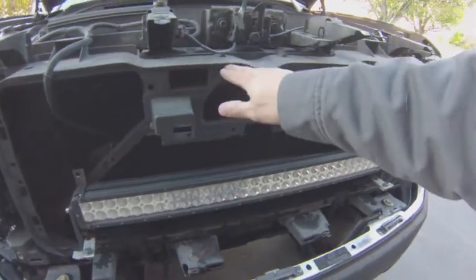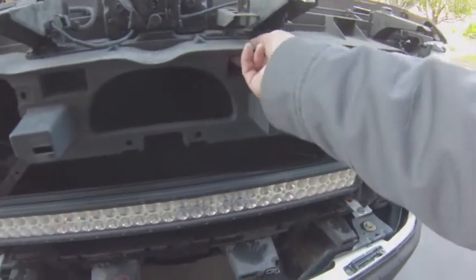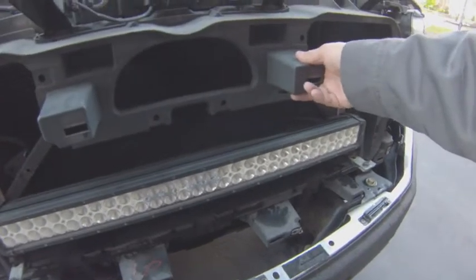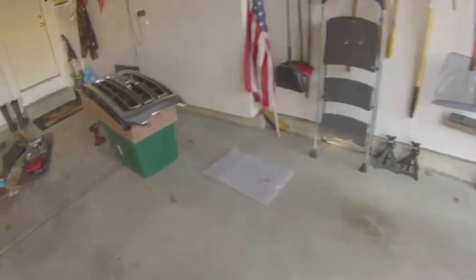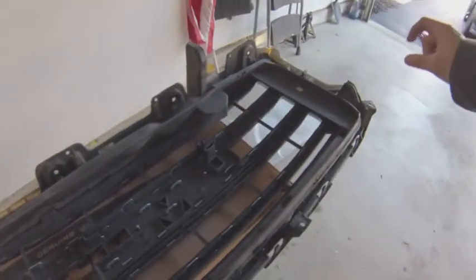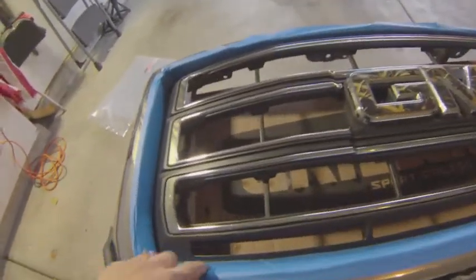I'll probably go ahead and zip that out — it's optional, and you could always replace it since it's bolted on the bottom with an option to screw the top. But since we're cutting out the center section, we don't need to mount to it anymore — that's what the original grill insert was held to. Next thing is to remove that section, then go back to the front and mask up all the chrome so we don't scratch it, then start cutting out the center section.